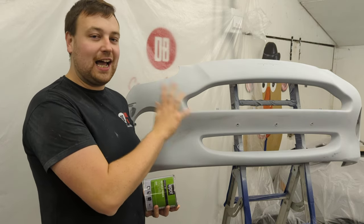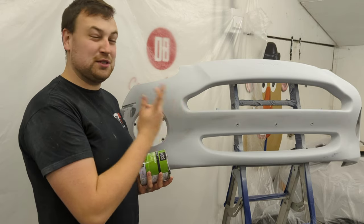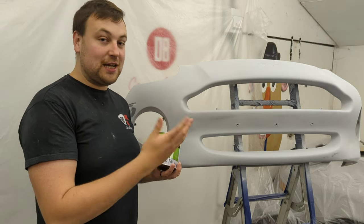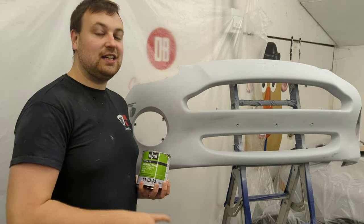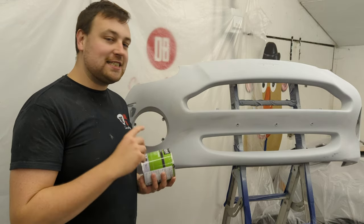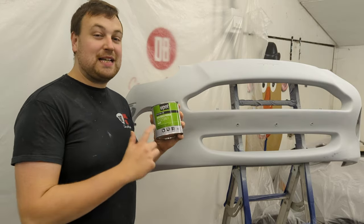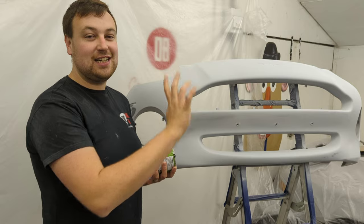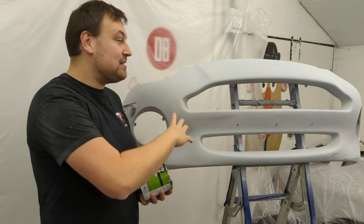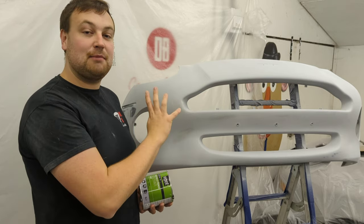Now I've rubbed the whole thing down again, however I wasn't really sure if I needed to. Obviously it's primer so it's porous, it's high build so it's pretty textured. If you're over-painting with new high build like two days later, do you need to rub it down? If you know, just leave a comment below because I'm quite curious. I'm guessing you don't but I've done it just in case. So basically I'm going to put this on now and give it a couple of coats. I'm not going to do it on camera but it's stuff you've seen before. So next time you see this it should be ready for its final rub down and then base coat and lacquer.